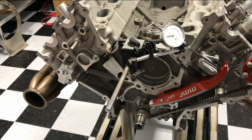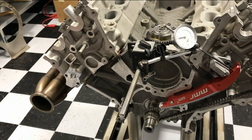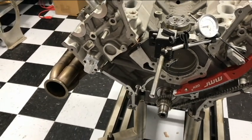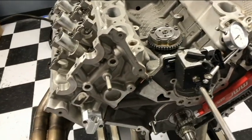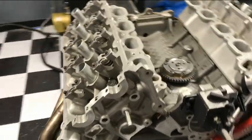In race applications, however, this becomes detrimental to the chains and tensioners, because the oval gear creates huge oscillation within the primary and secondary chain tensioners. The first video highlights this problem. Keep in mind the engine is being turned by hand, so just imagine what it looks like at 7000 RPM.